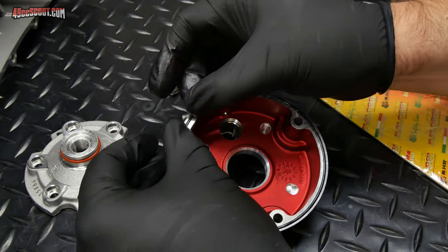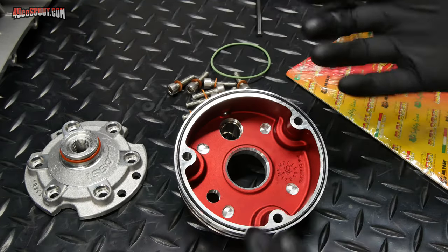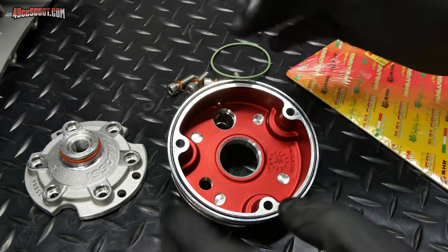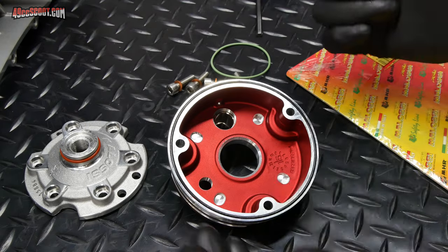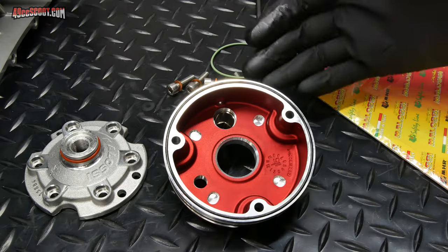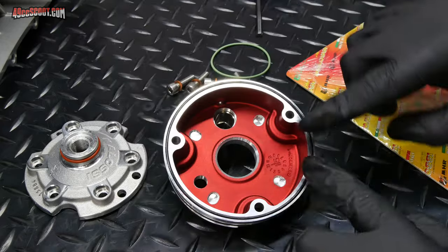and then get that situated into its groove. And one thing that I'll say about this Malossi kit, the other kit that I've worked with a whole lot is the TPR86cc, and a lot of times with that the O-rings did not want to sit in there. With grease or anything else, it could be kind of a struggle just to get the O-rings to stay in there, but Malossi is on point with this. It has been no trouble for any of these O-rings. Like I said, the other one got stuck in there kind of accidentally,